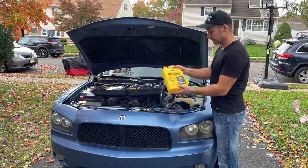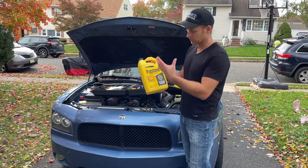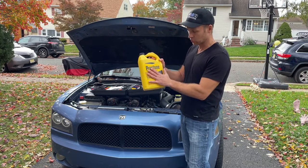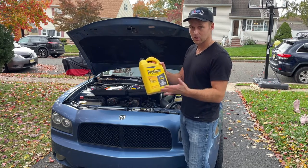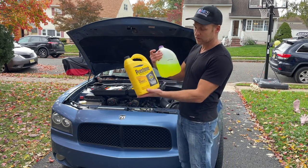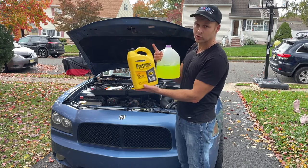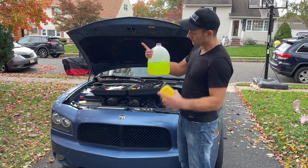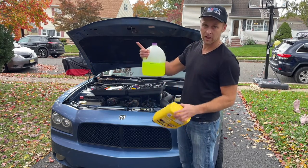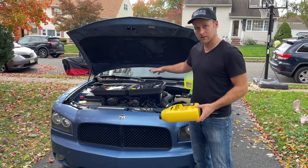First, I have to get some coolant. I got the concentrate — this is $20. You can get the 50/50, which is already mixed, meaning half water, half concentrate. Don't waste your money on a 50/50. All you need is a gallon of distilled water and a concentrate mix. Distilled water is $1, concentrate is $20, so basically for $21 you get two gallons of this stuff — double your value. I measured 64 ounces, marked the line, and that's how I knew how to go half and half in the gallon. So I already topped off my system.